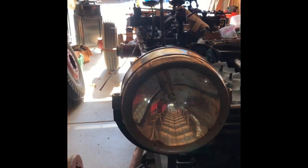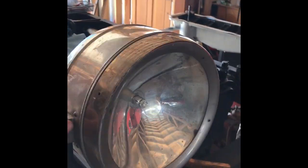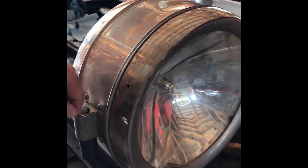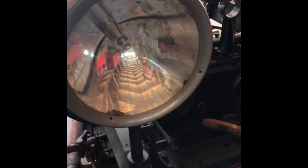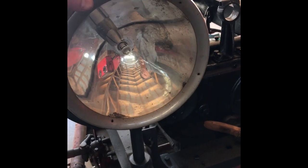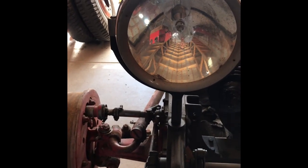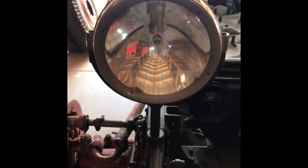I had also mentioned the headlights, so here's one of them — I pulled it out for you. It just sits on top of these little forks and has a set screw. I might make a bushing or some kind of shim so they're a little firmer than just a set screw, and that way I can make sure they're both exactly straight. I've got to figure out how to pull the dents out — I've seen people who know what they're doing pull that out, so we'll figure it out. The glass was clear, but I'd prefer a different lens.